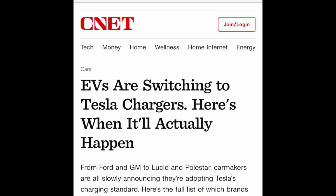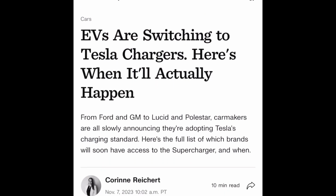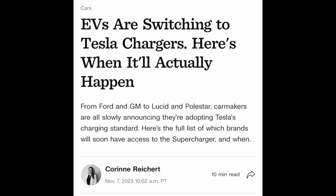I wanted to also add into this video that Lectron, as well as pretty much most other portable EV charger makers, as well as the ones who make the chargers that you can plug into the side of your house, they're all eventually going to be switching to Tesla's chargers. Now, it's a very simple reason why. Tesla made it so that you have a relatively small head on your charger, but it's capable of doing not only AC charging, but DC charging as well.